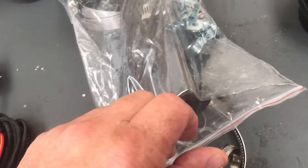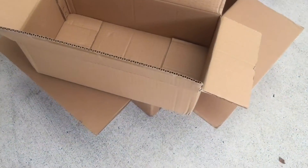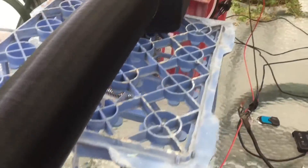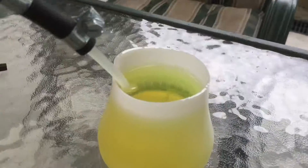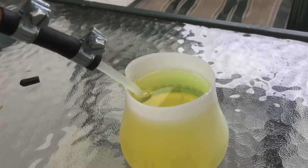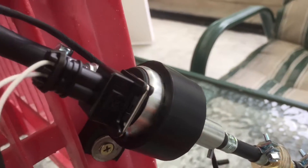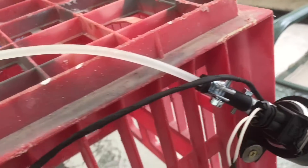I will do an install video but that will be in the second part. Okay guys, I just fired it up - this is just the test. She works, the fuel's just coming through now. This is basically how it's set up: there's your fuel going right into your filter. The fuel pump has got to be mounted at around 45 degrees in this little holder thing - takes the vibration out.